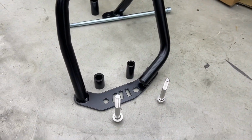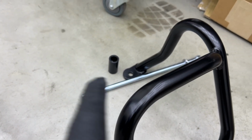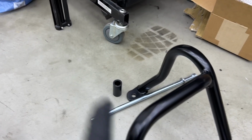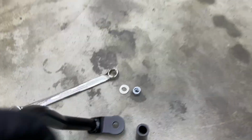And then you have the spacers. The shorter one goes for the right side. With the M12, we have 3, of course the long one goes top, right to left. You have the washers under there. These are the 50mm distance. You have one on the top there, one on the other side. On the top, of course, then with the nut. The nut is a 19mm.